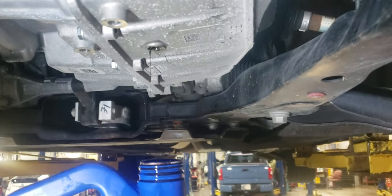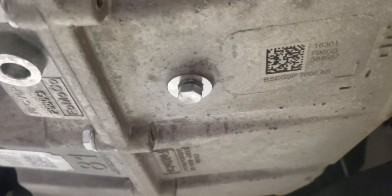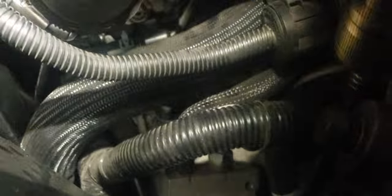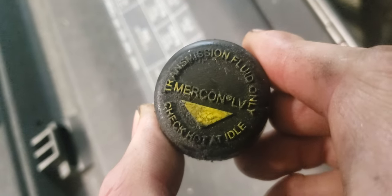On top there's going to be a vent tube where you want to put your transmission fluid in. Always start the screw by hand first as far as you can, then take a socket and tighten it up the rest of the way. Down here — that black thing there — there's going to be a little plug. It is your vent hose, and you want to put your transmission fluid in there. You'll need a transmission funnel, and you'll have to move the radiator hose out of the way before you can put the funnel in.